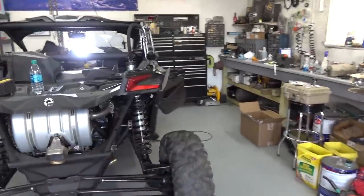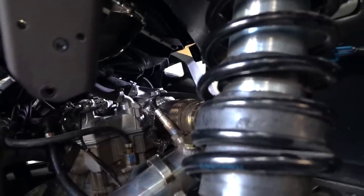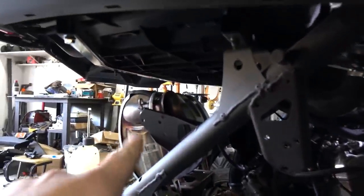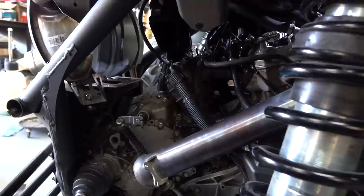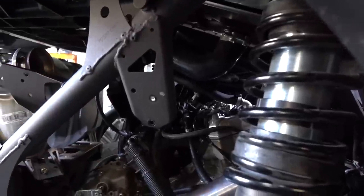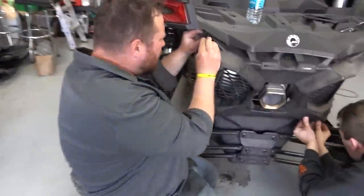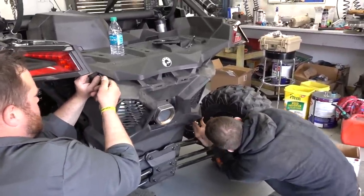Now it's time to run this bad boy — just killed like a crap load of pizza and now it's time. Jason's is pretty much done. Rick just got the cat delete pipe back on — that's the reversal of installation, just put it on, put the V-band on, no big deal, and mate it up to the stock exhaust. You don't have to reuse the gasket but you do have to reuse the four spring clamps. Heat shield goes on as well. Getting the final T-30s back on the back muffler cover — overall great work guys. You excited to run these things?